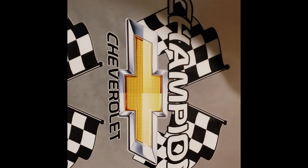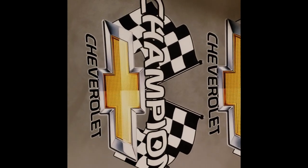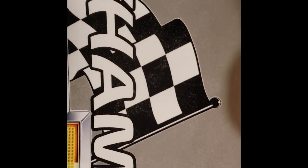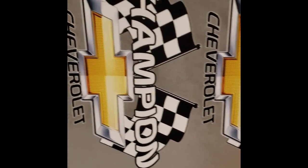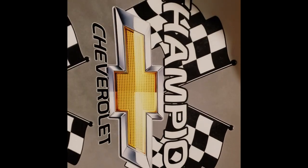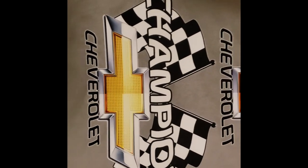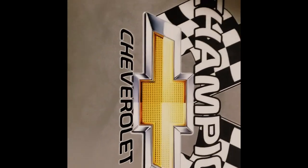Here's one of the prints I just did — it's for a dealership or a car club, I'm not entirely sure. It's a custom order. One issue I was having: the white wasn't showing up at lower DPI. My RIP software had a little trouble picking it up. What I did in Photoshop was copy and paste the image and overlap it a few times, which filled it in. If you're going to do DTF, I recommend getting decent at Photoshop — just a few basic steps, you don't need to be a pro.